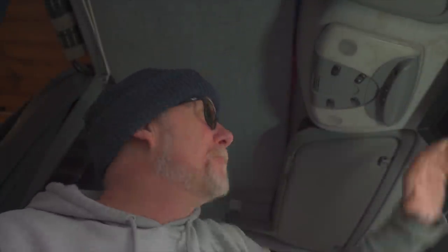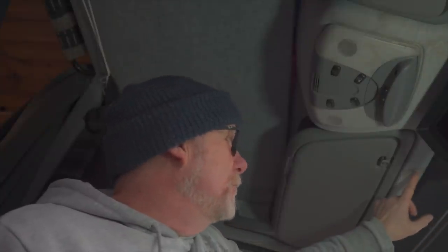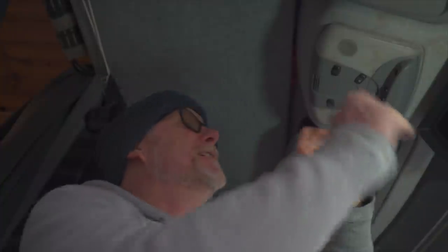A couple of mornings ago, when it was really cold and frosty, I actually woke up and found all my roof lining was damp. You can actually see water stains here and here — you can see where it was damp and wet. I was horrified; my immediate reaction was, oh no, my aerial's starting to leak. But as it turned out, it was just condensation. Nevertheless, when I pulled my light cluster down there were a few damp spots on it, and that's what got me thinking — I really do need to try and protect my light cluster from any water, whether from condensation or a leaking aerial. This is what I came up with out of sheer panic the other morning.